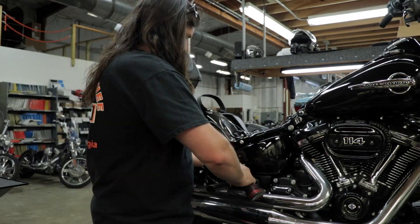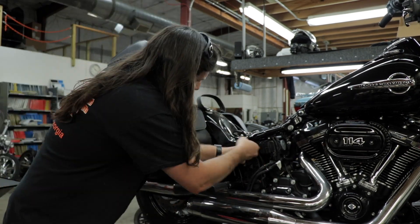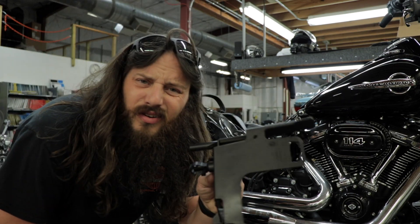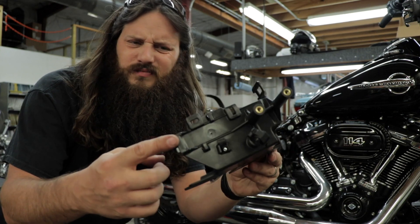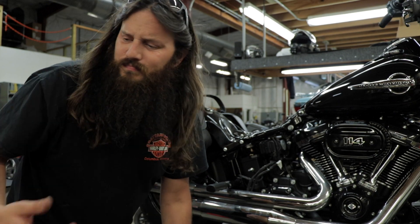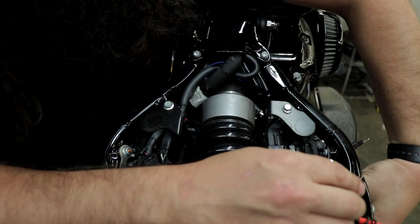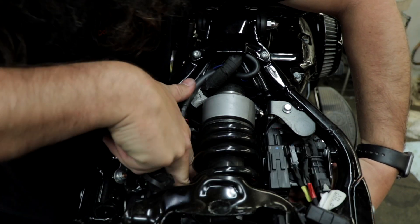Like my bike — enter this harness. I'm going to install it and show you what I mean. There's just no way to get enough space to get a jumper cable down in here. Really all you need is the positive, since any bolt on the bike would work as a ground, but even just to put this piece on I have to disassemble this bike more than I wish I had to. I should add: while I'm messing with the battery positive terminal, my ground wire is disconnected so I don't have to worry about arcing.